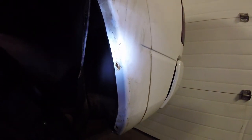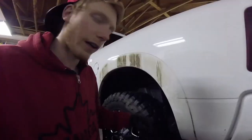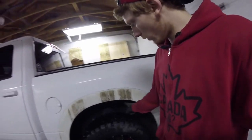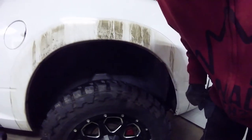So this one you can do at a bench — it's easier to grind but it's harder to get out. All right, so I took it out, I replaced the J clip, and now when I put it back in, you can see I replaced the hardware with brand new stuff. Reason being is it's a lot easier for me to get these bolts than it is to get those ones. So I'm going to close that up. I know that those aren't going to have an issue later down the road if I ever need to pull that out. Another thing I'm going to do is go a step further — as well as replacing all of these bolts, I'm also going to do the two in the back. Those are directly where the water is going to be splashing. So to prevent any rust on those guys in case that needs to come out, I'm going to swap those over without a doubt. And that way, everything in the wheel wells is completely stainless steel and will not rust. Then I never have to cut any of this stuff again and just mess around with it for a few hours.